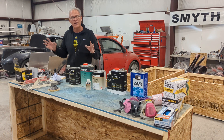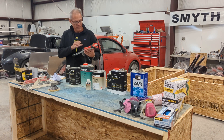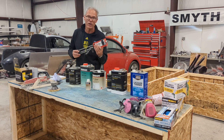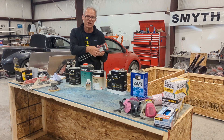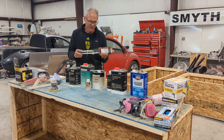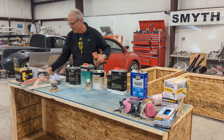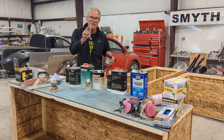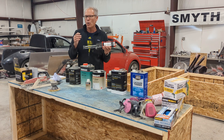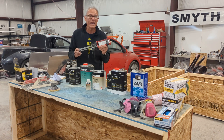You're going to be putting your fiberglass panels onto your car — in our case, with panel bond. It's a 3M product, a two-part epoxy. They replace welding these days with panel bond. You're going to have a special twin cylinder gun — you buy it on Amazon. It's a twin cylinder 3M panel bond system that mixes in the nozzle. Fabulous product. You're literally not riveting or mechanically bonding many panels at all these days — you're using panel bond.